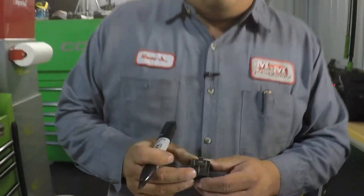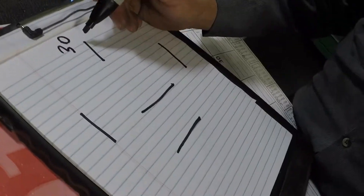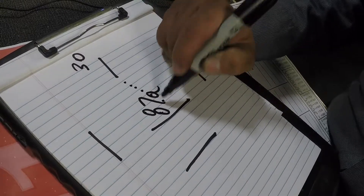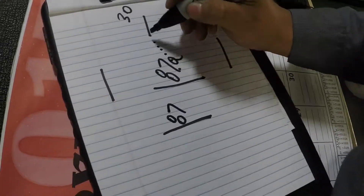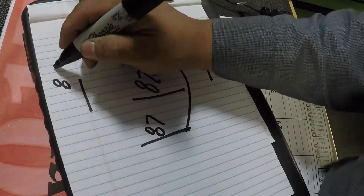I want to show you how a 12-volt relay really works. I have here the most traditional style relay — it's a five-prong relay. On this sheet, pin 30 is whatever you're trying to feed through the relay, going to pin 87a. The default connection is from pin 30 to pin 87a, and whenever you toggle this relay on, your connection goes from 87a to 87.